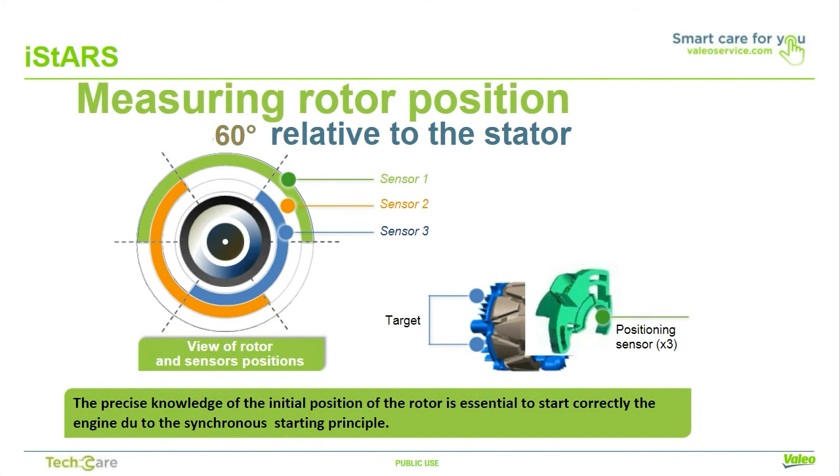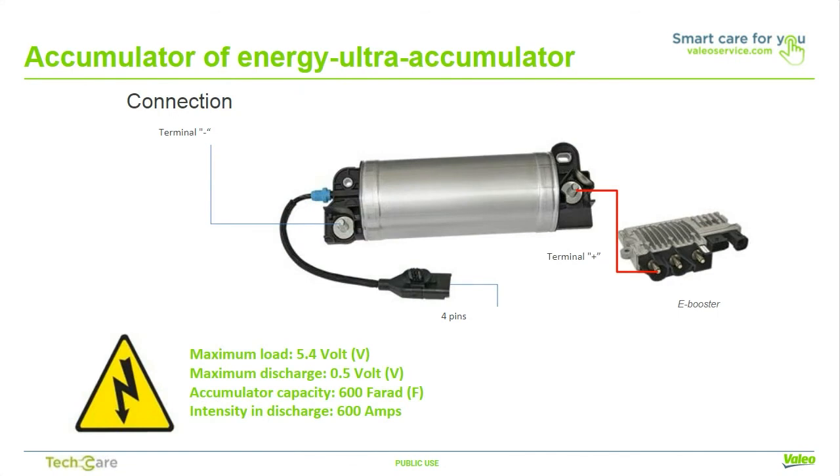The understanding of the initial position of the rotor is essential to starting the engine correctly. The position sensor is comprised of a fixed target magnet rotor having a number of pole pairs equal to that of the machine and a three Hall-effect sensor secured to the stator. With this device, position information is encoded in the form of three signals. In starter mode, the voltages applied to the stator are synchronized with the rotor position. An initial calibration is optimized for maximum starting torque. The STARS system must provide a minimum of 30 pound-feet of torque. A powerful booster module is required to deliver the power surge needed to assure easy engine starting even at below-freezing temperatures. The module needs to get the engine to idling speed quickly so as to make vibrations and engine noises practically unnoticeable within 400 milliseconds — twice as fast as a normal starter motor.